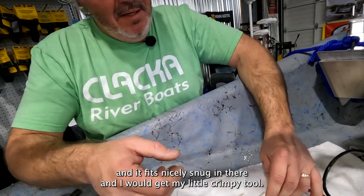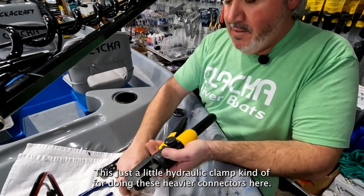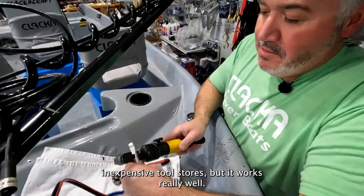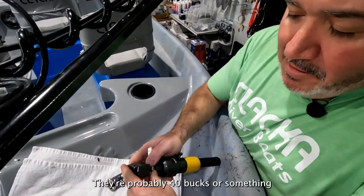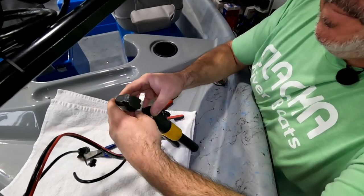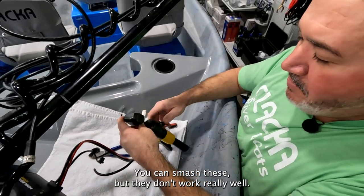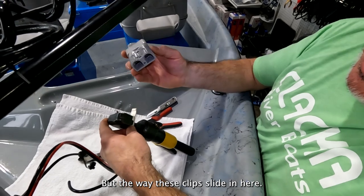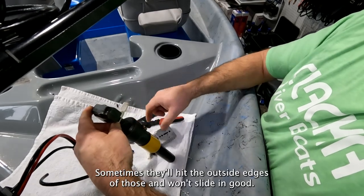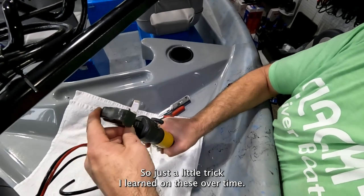I'm going to get my crimping tool — it's a little hydraulic clamp for doing these heavier connectors. I got it at one of my favorite inexpensive tool stores. They're probably around 40 bucks, but it works really well. For heavier duty connectors you need something to really clamp them down — the hammer tools don't work that well. I kind of always do these at a little bit of an angle when sliding the clips in — they seem to fit better when the tool crimps them down. Just a little trick I've learned over time.